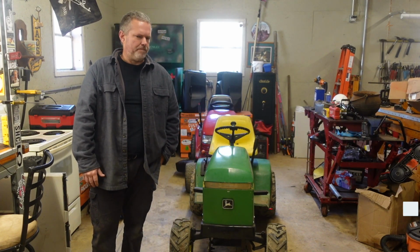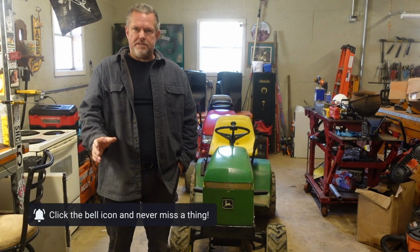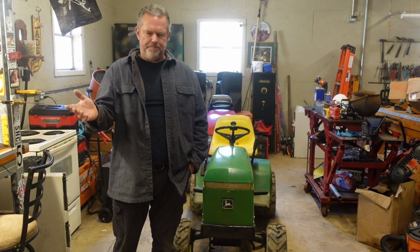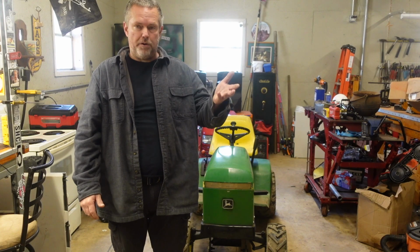What's going on, everybody? Today we're going to be swapping out a corporate Chevy 14-bolt axle in a 2016 Chevy Express. The reason I'm doing it is because my Chevy Express came with an open differential axle and I want to put some sort of limited slip in it. So I found another axle from another Chevy Express that came with the G80 option that has the Eaton clutch pack type limited slip differential installed in it from factory.